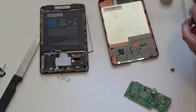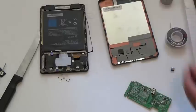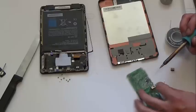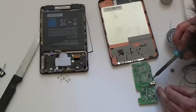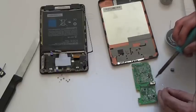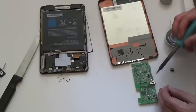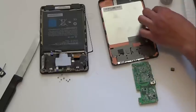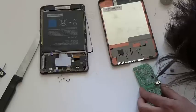I've got a little bit of solder — I'm using 60/40, and it works; I've done a couple others. So let's go ahead and put a little bit of solder on these legs, front to back. I just want to make sure that when I finally seat the legs, they'll have something to seat to. You don't want solder in between the legs, but at this point we're just putting solder on — so that could happen. Just keep swiping, gently and patiently, until they all clean up.